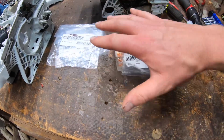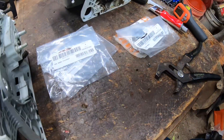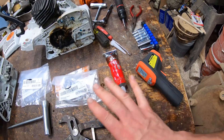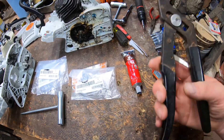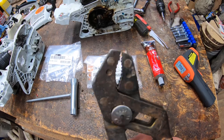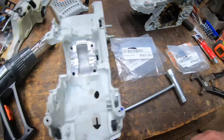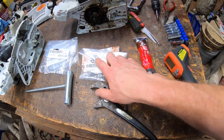This stuff you'll have to get at your Stihl dealer. A couple other tools: we're going to need a T27 torque bit and a temperature gun of some kind. I'll have this stuff linked through Amazon in the description of the video, or in the shop tab when I can. A wide mouth set of pliers — they've got to open up pretty wide because you need to grab the bearing. You're going to have to heat this bearing up. I'm just going to be using a heat gun. I believe we've got to bring this bearing up to about 250 degrees for it to get on.